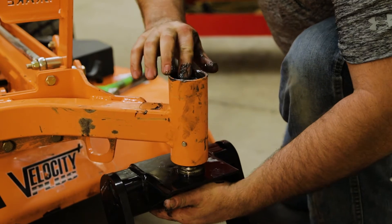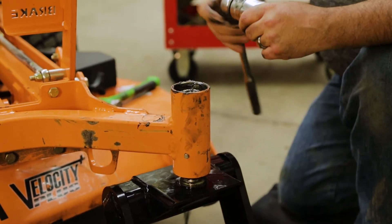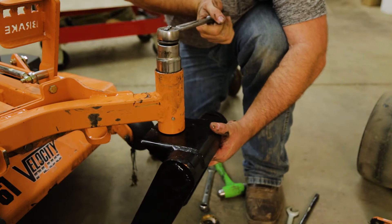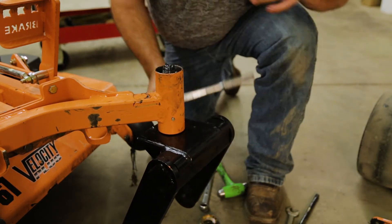These are cone bearings — we're not going to over-tighten them. We're going to seat them down in there. As I'm coming up on it and begin to feel the bearings seating, give it just about a quarter of a turn. Got a nice feel to that. No play. Looks good.